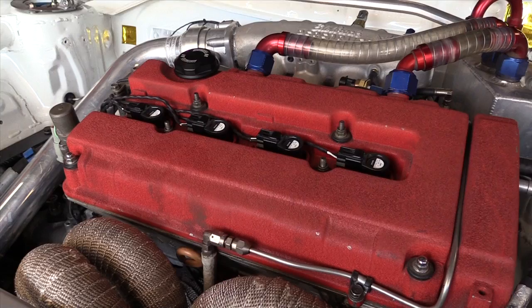Yeah it's got a major engine swap. We found that continuously running with the Daihatsu engine we ran into transmission problems — dog boxes did not work — so I tried to find a combination that from factory was strong, and on top of that we went with an aftermarket gear set. It's now running a Honda B-Series motor, still 1.8 litre, sleeved with Darton sleeves by Bakers in Orange who do a lot of top fuel drag cars. On top of that it's running an ERL five-point main girdle, Manley turbo tough 1000 horsepower rods, Wiseco pistons, 10-to-1 compression, standard B16 cams and a full valve train kit with a CNC ported head. Last time on the dyno at 24 pounds boost on E85 it laid down just on 500 horsepower at the wheels.